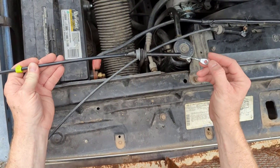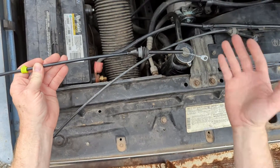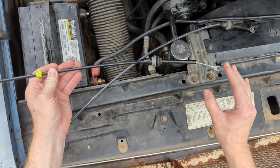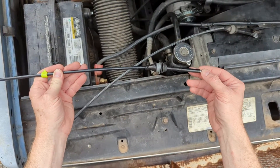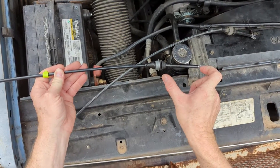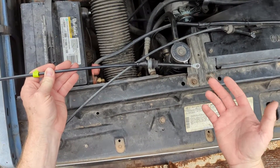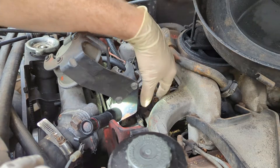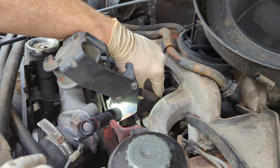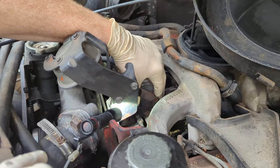The challenge is, when they ship this to you, this metal eyelet is too small to fit over the spot where it mounts. So I just took a drill and drilled it out to make it big enough. It attached and everything seemed okay, but I came to find out that the distance from where it mounts on the motor to the other end is too short. So it's pulling the accelerator — at idle, you're idling incredibly high. Because this distance is shorter, while it's installed it pulls back on the accelerator, so instead of being all the way down, it's starting the motor at high RPMs. You cannot turn down the RPMs because the cable is too short.